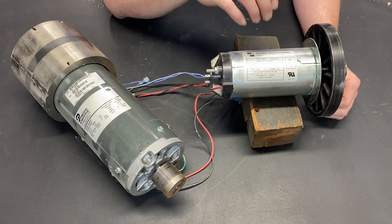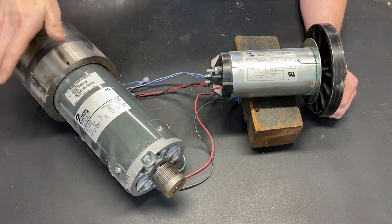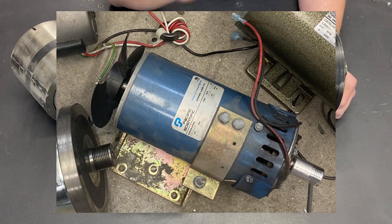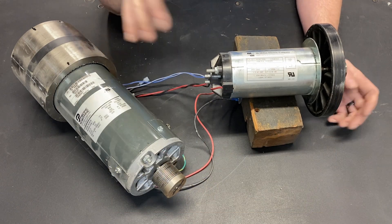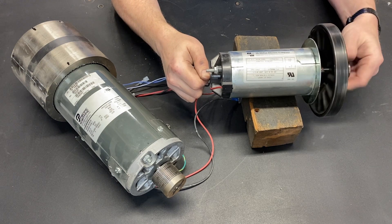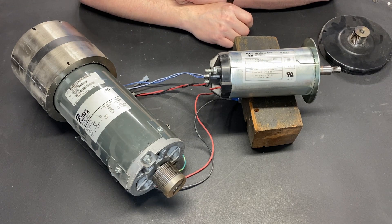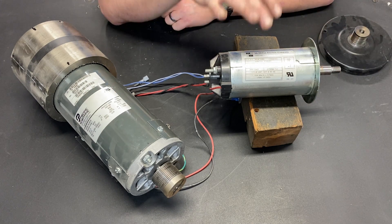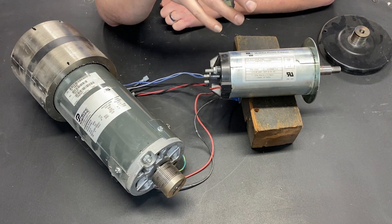The next mistake that I see is people don't run a cooling fan. On this motor the cooling fan is part of the flywheel, and on this motor the cooling fan is also part of the flywheel. But on some motors the cooling fan is external. Most of the time when the cooling fan is external, people are running the fan. But when it's part of the flywheel, people are removing the flywheel because it makes it hard to hook up, and they're not adding another fan. It's super simple to add a fan — just get a plastic fan that fits over the snout and you have cooling. Make sure that if you are running a motor like this, it has a cooling fan because it will get hot.